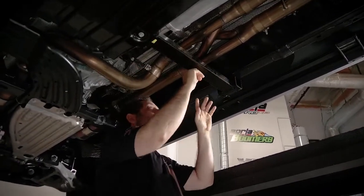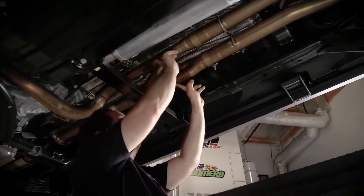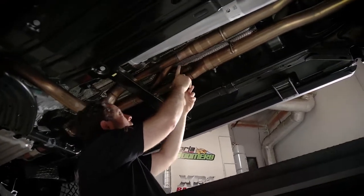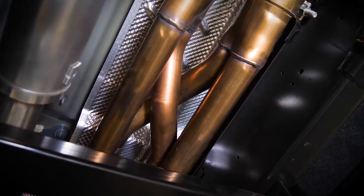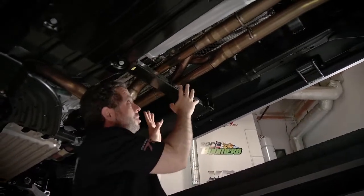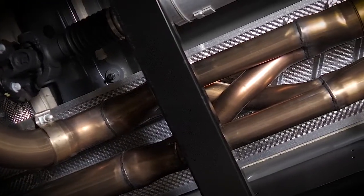You can see how the SwitchFire design works. There are collectors here breaking up each bank into two — half of it is going to go straight through here, and that's a big reason why our X-pipe is going to outperform the stamped X-pipe. You get a much cleaner crossover design, and it's not done arbitrarily. This is patented technology. We have a separate video if you want to watch more about our SwitchFire technology.